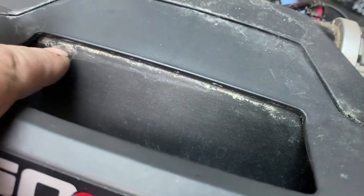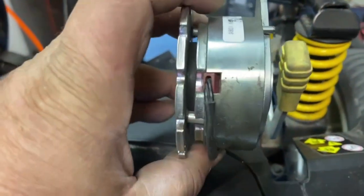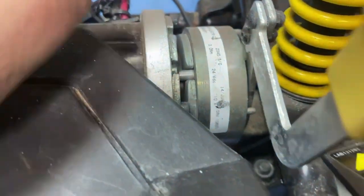So imagine this is still on the scooter. And what I see here is white. White along here, white along there. While it was still on the scooter I couldn't see anything else, but I could see the brake. Now, when you have a brake, they're normally pretty shiny like that. Maybe a bit of dirt on it, but they're pretty shiny. But when they're like this, a powdery colour, where it's just dull, and this is tarnished as well, that means there's moisture gone into it.